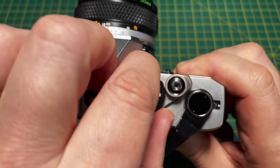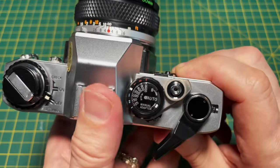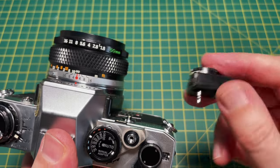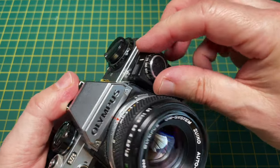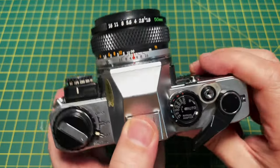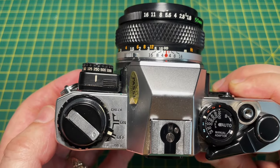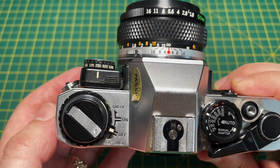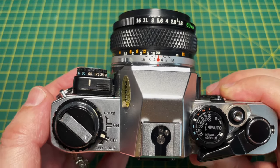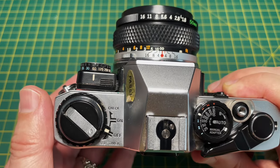The last setting is manual mode, for which you'll need the manual adapter. You add it — just that prong goes in there — and there you have manual exposure. You just see which shutter speed the camera recommends, and you then set that on the knob here. This is useful when you don't want to rely on the OM10's automatic exposure, for instance if there's a big difference in brightness between foreground and background, and the camera meter can sometimes be confused.